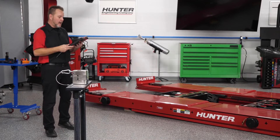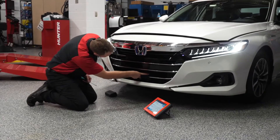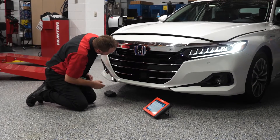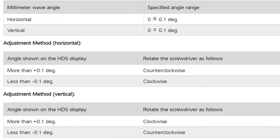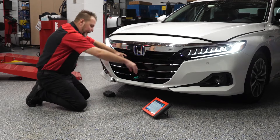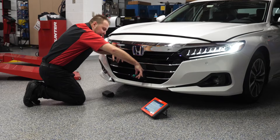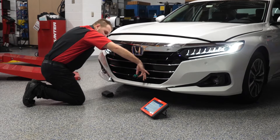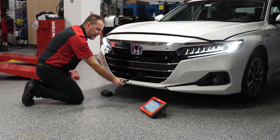I'm heading to the front of the radar, removing the cover, and grabbing my 3.5 millimeter screwdriver. There are two adjustments — one for vertical and one for horizontal. If you're blocking the radar while adjusting, it'll read 12.8, so you have to stay back a little and adjust until the values are within tolerance, at which point you'll be allowed to press continue.